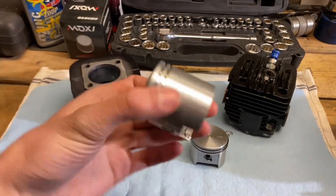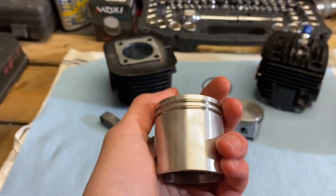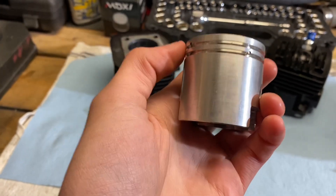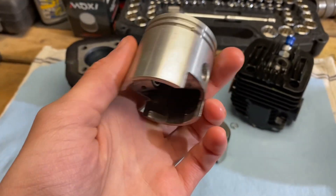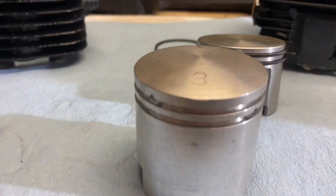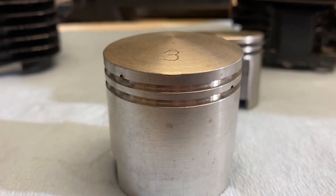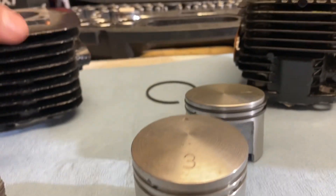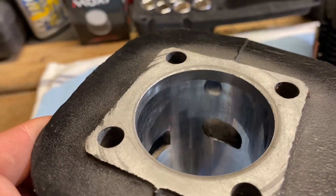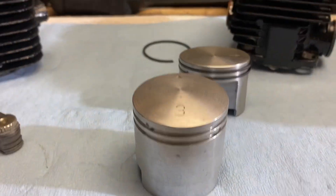The first thing I want to go over is why does everybody tell you to put the piston on the intake side? They'll tell you to put these pins on the intake side. The reason everybody gives — and I definitely agree with this — is on some cylinders, those two pins right there can actually come in contact with the exhaust port. Let's say you put it in wrong, it can come in contact with the exhaust port. That is the reason everybody gives.